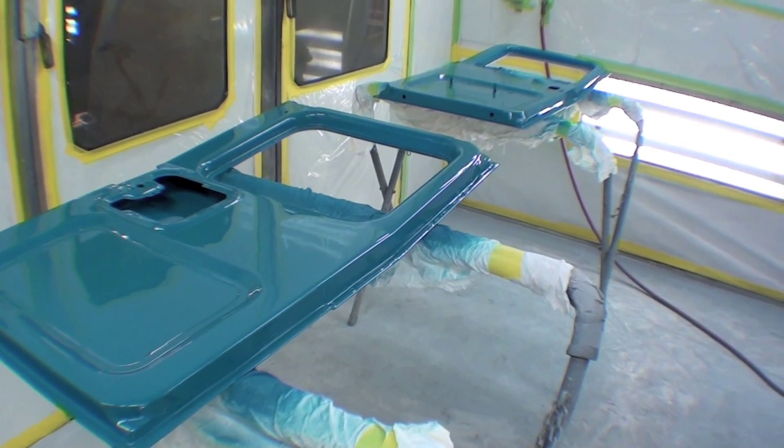This is obviously an ambulance door. This is a left-hand door, driver's side. That's a really key position where a striker comes down and bolts in with some linkage here. Same thing on the other side — this is where the handle goes. Right here is where the license plate on the opposite side would go, and this is where the little tabs are for the wiring harness that is going to make the lights come on. You can see this side is not painted, but we have vinyl paint on the inside. This bracket right here is where you can also have a recoil for the front driver's passenger side seat for the seat harness that goes on the hard top.